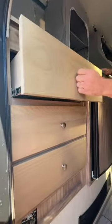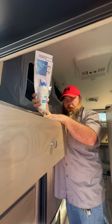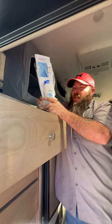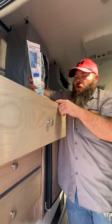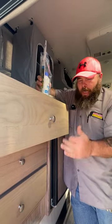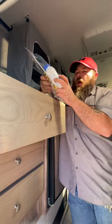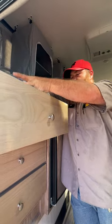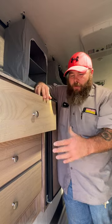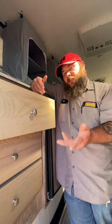You've got your drawers up here. In the top drawer you have the cleaning chemical for your toilet. Two ounces will treat a 40-gallon tank, but you don't have a 40-gallon tank on this coach, so I'd recommend a one-ounce shot glass or a one-second pour. Always put this in before you start using the tank. Once you dump, you'll need to put the chemical back in. I always like to say put the chemical in and add a little bit of water so that solid waste doesn't stick to the bottom of the tank and start forming what I call a poop mountain — because then the smells can start to come through the coach.